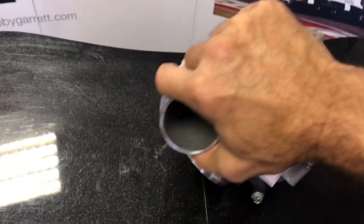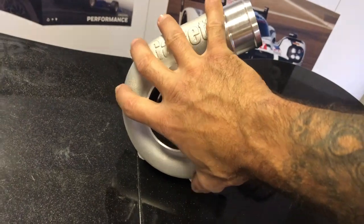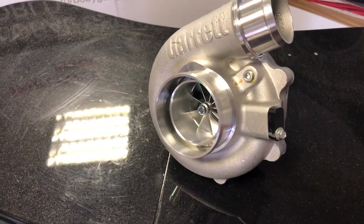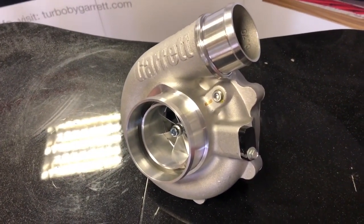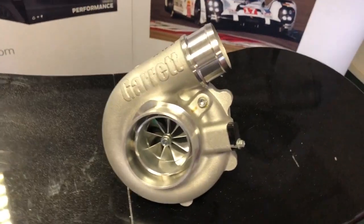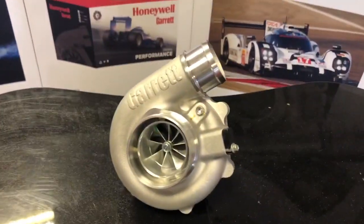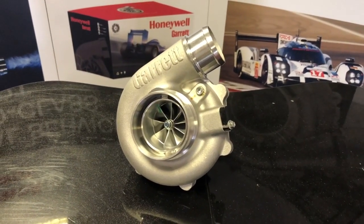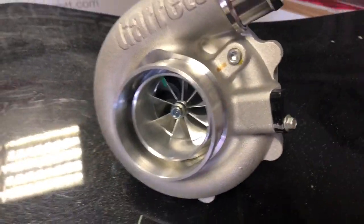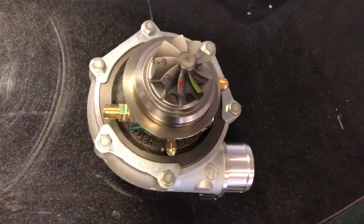Looking at the physical size of this turbo, you'll actually notice that the size of my hand is pretty much the size of the entire compressor — it's a really compact, high-horsepower offering from Garrett. It will spool up faster than any other turbocharger in the same family and make more power than a turbocharger up to two to three family sizes larger. Cast your mind back to the day when the only turbocharger capable of 600-plus horsepower neighboring the 700 hp category was the GT3582R, which is approximately four to five family sizes larger than this. This turbocharger is supplied with a boost-only speed sensor port, packs a serious punch, and is proven in the industry.